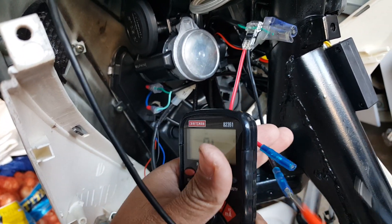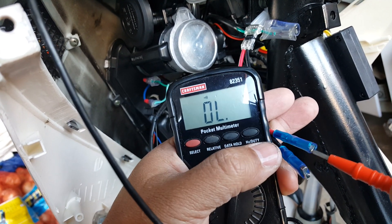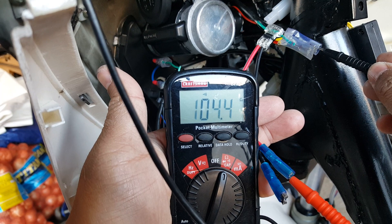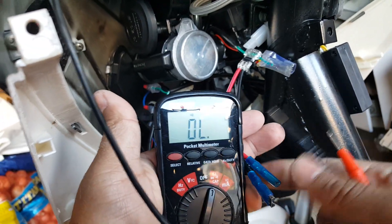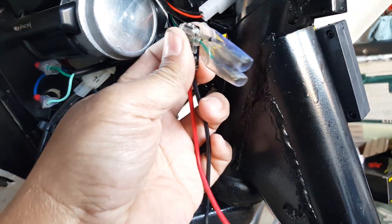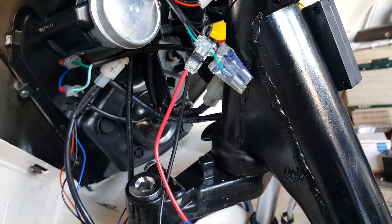Let me hold these two so you can see the open ends. I'm going to probe the red one. Now I'm going to go ahead and probe the black one from our wire harness — not the green one. You guys can hear the sound — great. And then if I put the green one, nothing. Excellent! So we do have good continuity on both these wires; they're going to the correct path we thought they were going to go. The connection looks pretty solid — you don't have to worry about any extra tie strap. You can pick these up on Amazon. Yeah, for smaller projects like this where you need to tap in, I think they work excellent.